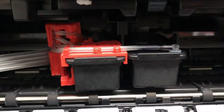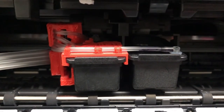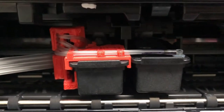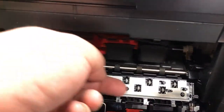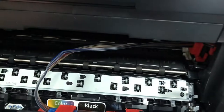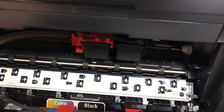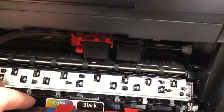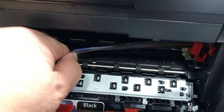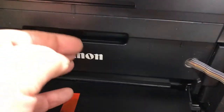This is what it looks like after you insert it. You can see the color one, or the orange one, is just a tiny little bit lower than the black one. It's easier if you start by moving the cartridge all the way to the right. Because if you stop here, you have to tuck this in and close the door together without twisting or kinking it.